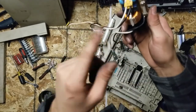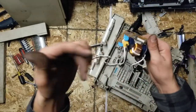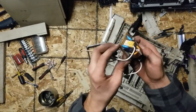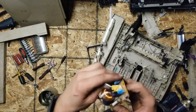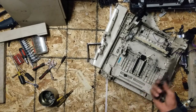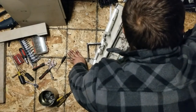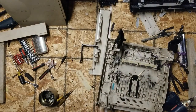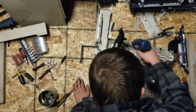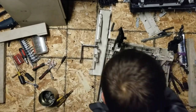Very good. This actually might just rectify everything and then go down to the control board, and that's why all those little individual transformers are on the control board, because all this does is rectify the DC, and the control board handles the actual voltage dropping. Very nice. Very cool. Put that in the pile. Slip the inductor core off and keep that in the pile. That's it. Okay, we're so close to being done with this thing. A few more screws. Moving along.